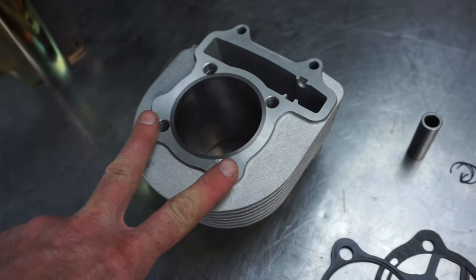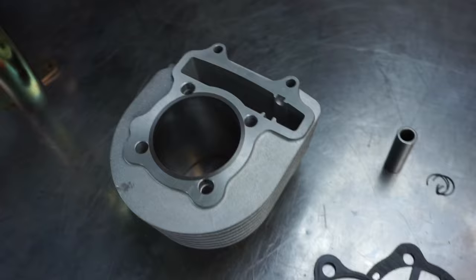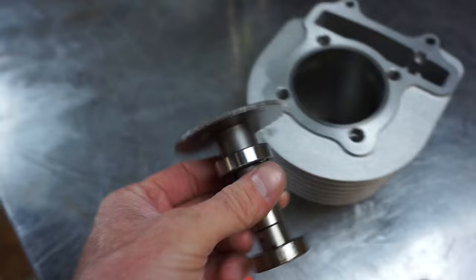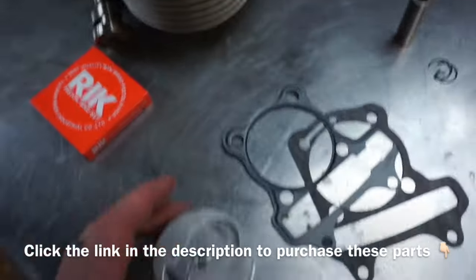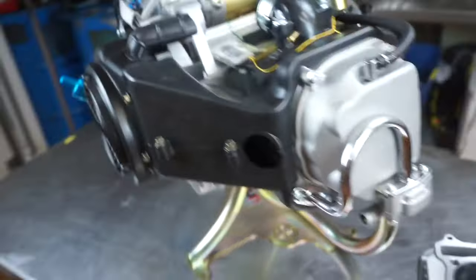The GY6B motor, which is made in Taiwan, has a wider stud diameter, so for the GY6A this is the largest you can go. It is a little bit paper thin, but I've never had any problems. We've also got an A9 camshaft, rings, piston — and this is actually a brand new motor we're just going to start fresh with a 171cc big bore kit.